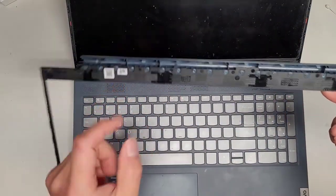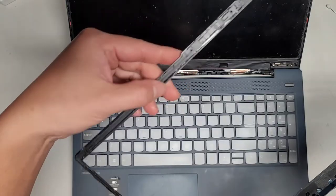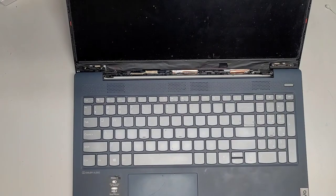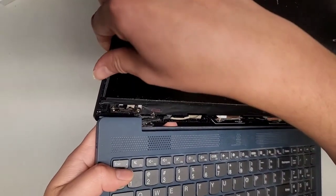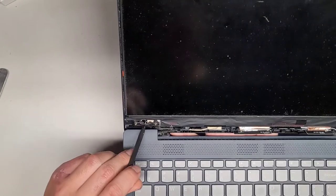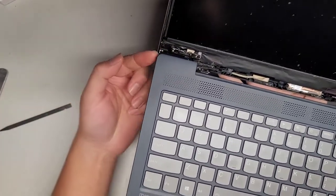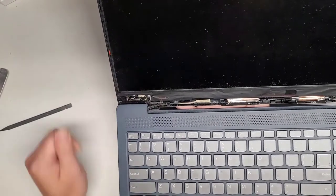Here you can see this blue piece is actually part of this plastic part, and there's some adhesive on there — they would have adhesive all the way around. You can see on the top frame there's also some adhesive. I peeled some of it out because it was getting wrinkled, and you don't want to leave that; the adhesive isn't really necessary for holding the frame together. And here you can see the broken screen hinge area — this is going to be somewhat of a pain to repair. Underneath the hinge there's a pull tab — it's a stretch-release adhesive, so you have to pull it straight along with the screen. Usually I pull it through the edge down here and keep pulling it straight down.